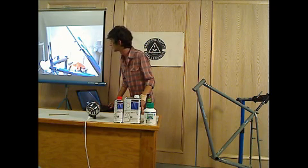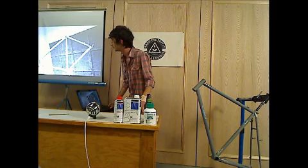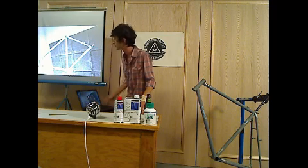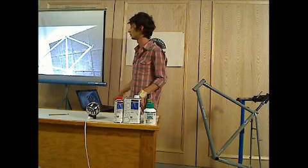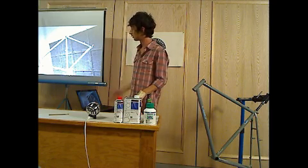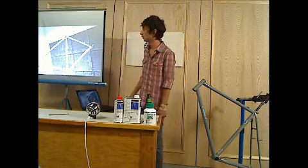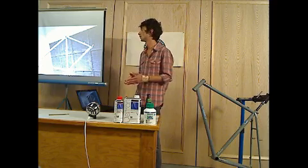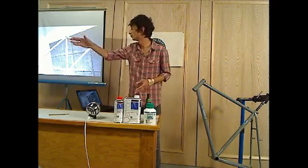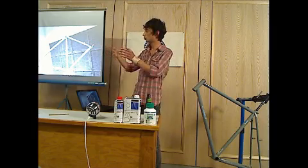But yeah, and then you get more standard stuff like just flames, a lot of popular flames there. So that's just a bare titanium frame right there, which pretty much looks the same as a bare steel frame. So that's what I'll start with in the booth. And these are just the filters in the background. There's also different kinds of booths. This is a side draft, which has an intake filter over on this side, and then the outtake filter over here. So it would just draw it through this way.